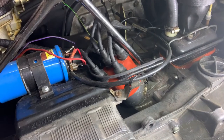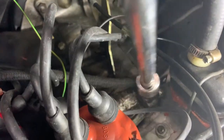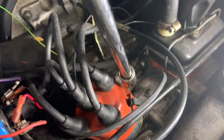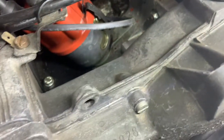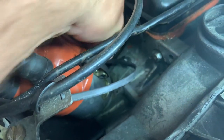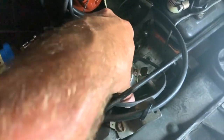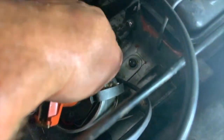Back on the Type 4 engine to pull the distributor — it's that nut right there. The other nut back in there is actually for adjusting timing, but we'll need to re-adjust timing with the new one once it's in. Remove the nut and the washer, then just pull the old distributor straight up and out. Now drop the new one down in there, make sure it goes down fully and is seated on the bolt nice and secure.